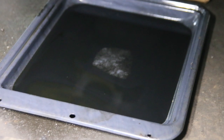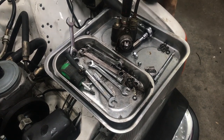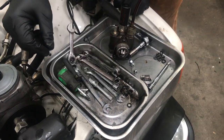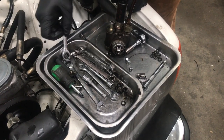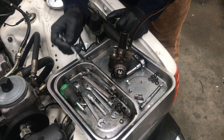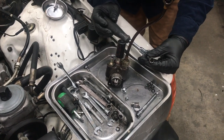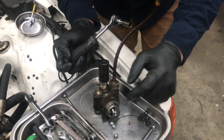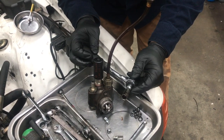Number two is tools. It's only three bolts, but getting to them is the hard part. As you can see, I've got a plethora of 10 millimeter wrenches — angle wrenches, box end, ratcheting, even a short stubby — but that would end up being too long. We found that if you have a nice flex head ratchet, you can get to the forward lower bolt and run that in with the ratchet.